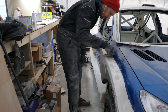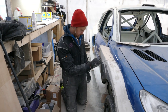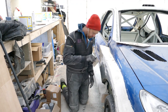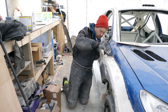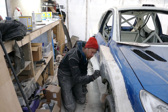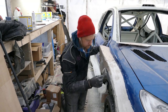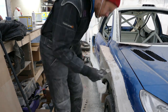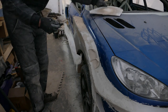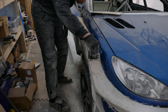The bit I'm working on now - the tips of the wings - I want to make them round slightly. If I make them really sharp it's going to cause issues when it comes to the MOT and making it road worthy, so it's important to get a nice round edge on all the sharp angles. Unfortunately I can't take the doors off the way the panel's set up - the driver and passenger door can't be removed at the moment, so I'm going to have to take the molds with the doors on the car, because I can't get to the bolts.